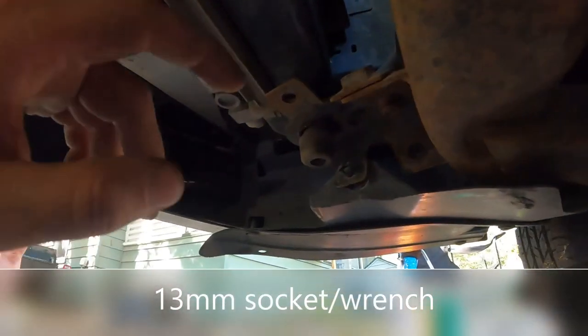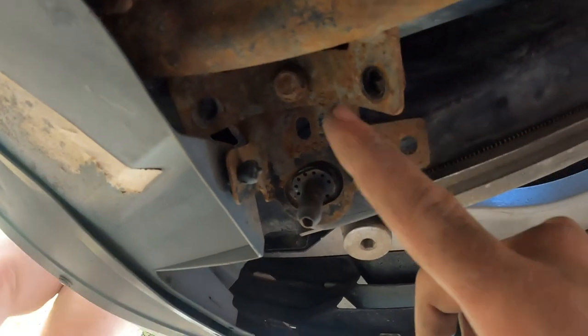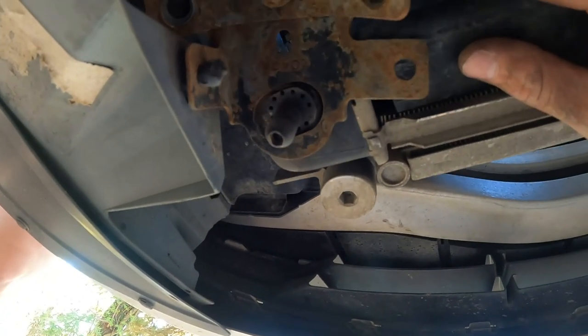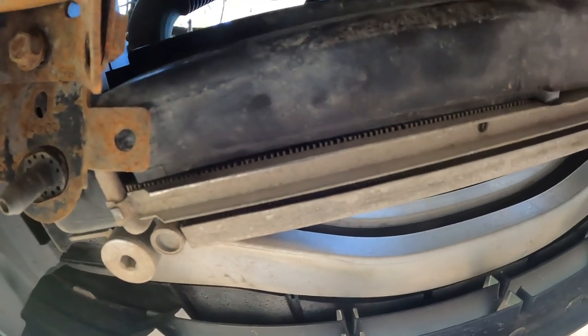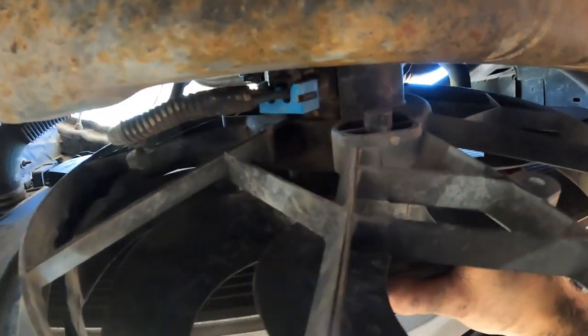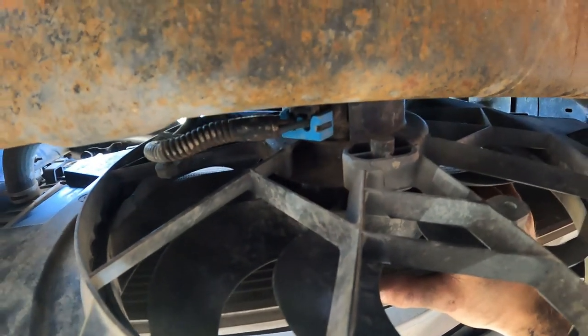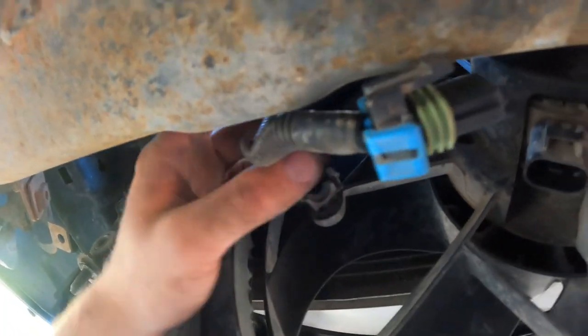Once you've got that little shroud out of the way, take two of the bolts out on the two sides and just loosen the middle one — same on the other side. That gives us a lot of play to lift the radiator up, push it forward slightly, then drop the fan down. The plug is there, so pull it down a little further and unplug it. Push down on the tab right there and it'll come out, then slide this part to the side to release the wire. Now the fan is completely free.